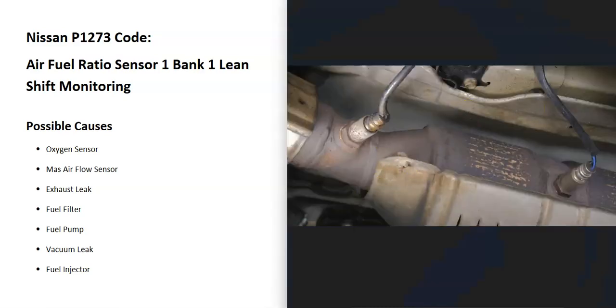What does this mean? These sensors are located on the exhaust and they do two things. First, they monitor how much oxygen was burnt off during combustion, and then the onboard computer uses this information to adjust the air-fuel ratio mixture going into the cylinders. Second, they have heater elements built in, which helps the system go into closed-loop quicker. The bank one, sensor one is reporting back to the onboard computer that too much air is going into the engine and not enough gas.